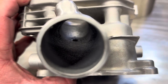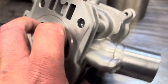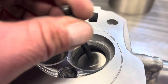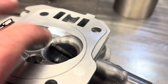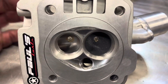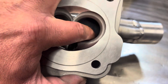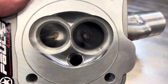So this is going to be a look at the port — a monster. Cross-section in here is 27 millimeters, which is ginormous for one of these. There's the exhaust valve going right down in there — that's a 28. That's a 3220 valve that just literally slid down the port. It's really a big port where you can literally just slide an exhaust valve right through there. I thought it was 27; it must be a little bit bigger — probably 29 across, 26 tall. So it's a 27 area.